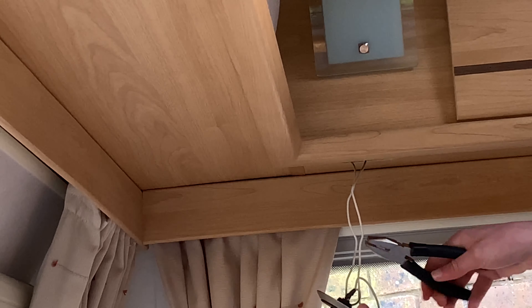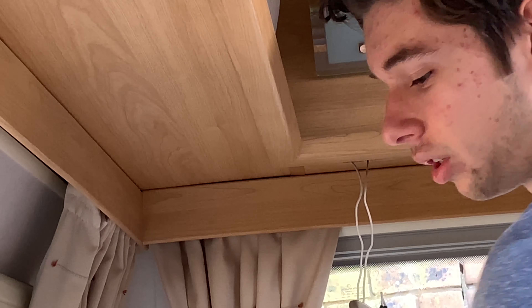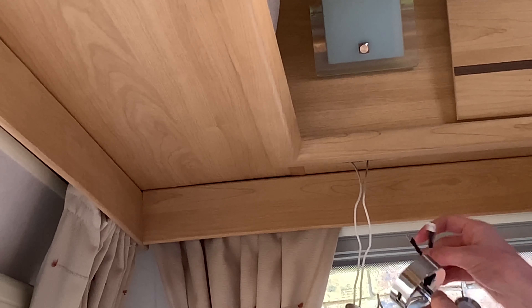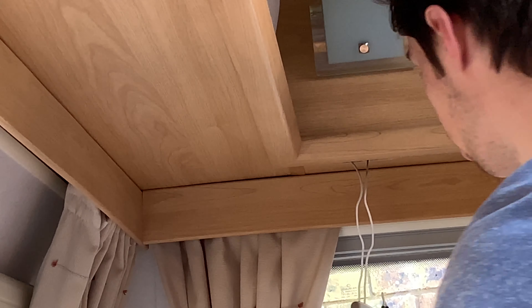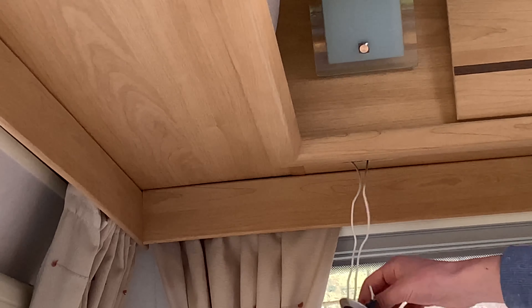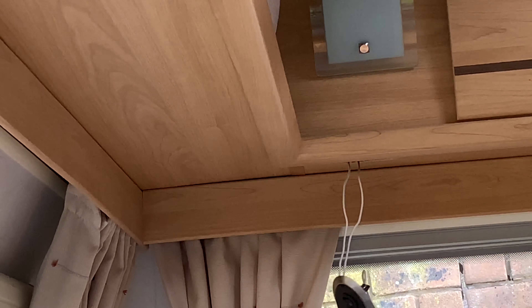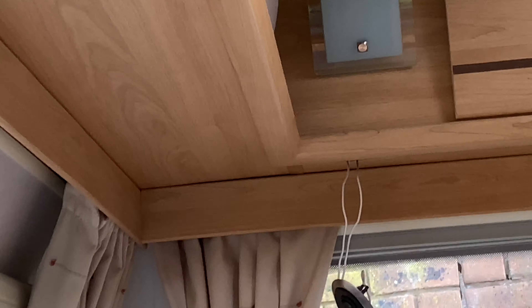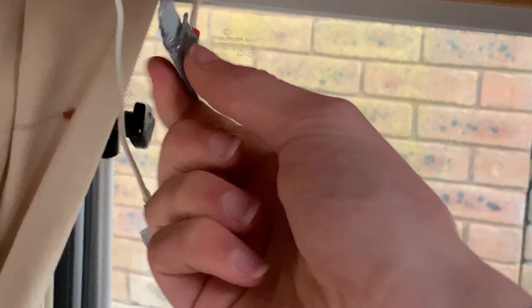If you're lucky and these were just pull-off connectors, you'd be able to click the new ones in and away you go. But if you're like me and they've been soldered together, you'll need to figure out which is positive and negative, cut the wires, and solder on spade connectors — or chop the spade connectors off your new lights and wire that into the harness. I've disconnected the battery for safety. I've already crimped one side and tested the light, so I'll show you the other side.